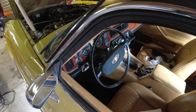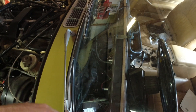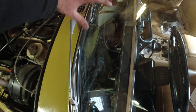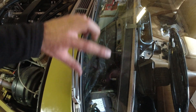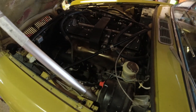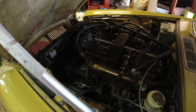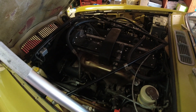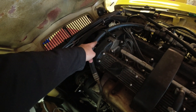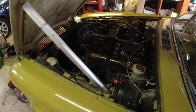MOT is tomorrow. I just fixed some electrical things, fixed the speedo cable, put the dash top back on. This piece of rubber with the mirror flap was missing - it was in the boot so we'll put that back together. All leaks seem to be fixed. I'm seeing a tiny oil drip up front which seems like the front main seal - not going to do anything about that, it may get better with use. I still need to clean out the gauze in the crankcase ventilator.